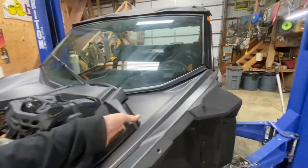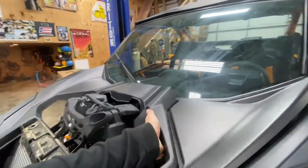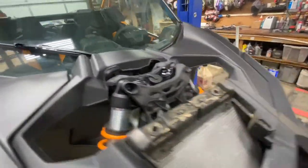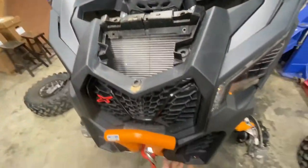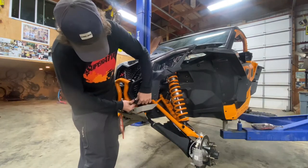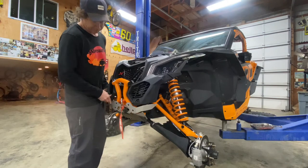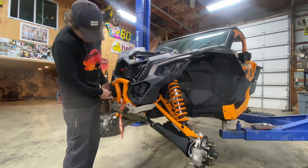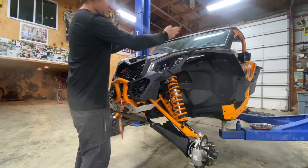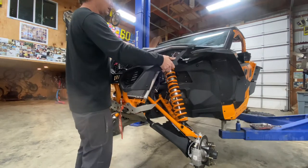There's a bolt right there and a bolt right there, and then on the other side of the headlight adjuster there's a little wood-screw-looking bolt - a T20 - take it loose so it loosens the headlights from the fan frame. Once you do that, pick up and get everything loose. On the front end once you get these loose you've got to pick it up and get it past, kind of one side at a time. It will come loose, then everything will scoot back because it's all loose - scoot it all back, pick up on it, and then the whole nose comes off.